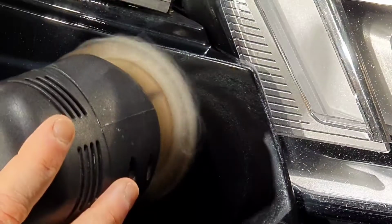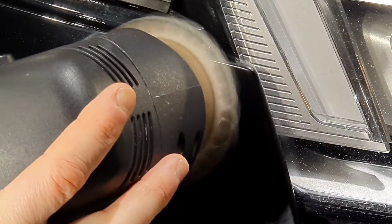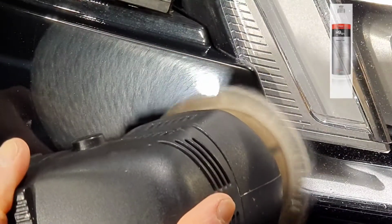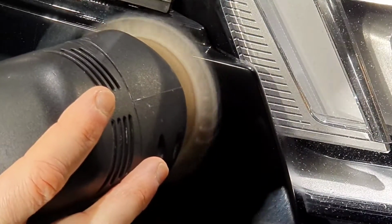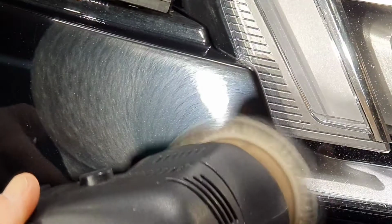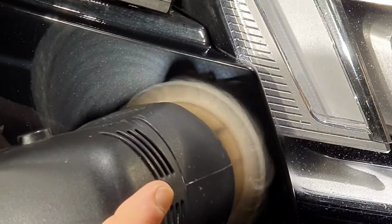So job one when it comes to machining is the sanding marks. If I'm going to create any dust at all, it's going to be at this stage, so I want to do it first so that I can clean up as and when required. For this stage I'm going to be using Koch Chemie H901 coupled with Buff and Shine Euro Fibre pads. This will be on a small 75mm machine. Compounding like this allows me to work in small areas very safely, producing very little heat.